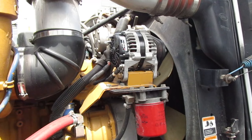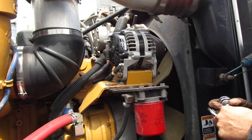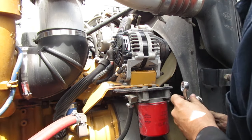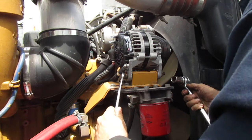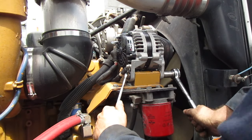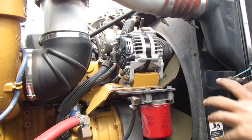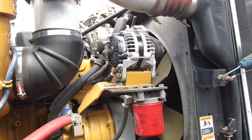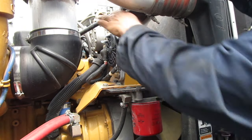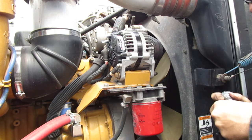All right, here we go. I don't know if the guy broke something when he put the alternator on or what, but after I took them off I inspected them and those belts were in pretty decent shape. It was just time to change them. Like I said, I've already done this once today — this is super easy. So I'm loosening up this bolt right here, we're going to loosen up this one right there, and then there's one in the back right here.